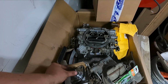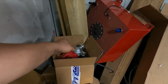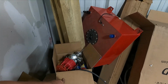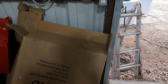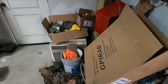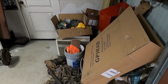We got our water neck, we've got our voltage regulator to make the original alternator on the 5.2 work. We have an HEI distributor, so we're not gonna do points. It should drop right in. That's made for an LA and it should drop right into our Magnum. We have an aluminum radiator. From the measurements that I got, this should work. It's for a 1955 to 57 Chevy and it has a transcooler, so we should be able to cut the lines and hook the lines up.